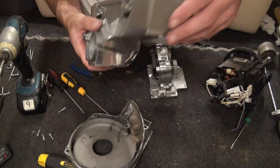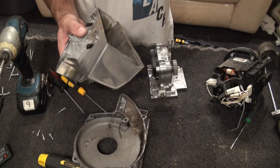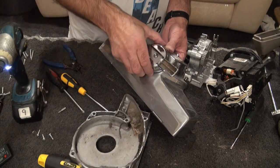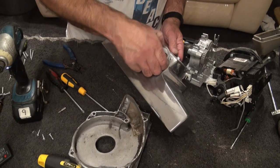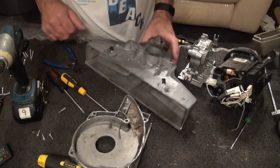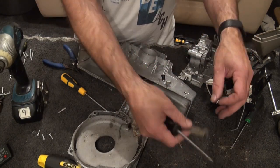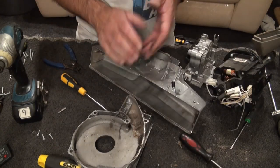We've got our bumper, so we'll take the bumper off — that's all going to soak. Take that off and you can keep these separate if you want. That can go into wash. So this head's going to go into wash too. The only thing we have to take out is the brush roll sensor — that little Phillips screw there. We'll give that a clean. Then all this can go and soak in some hot soapy water.